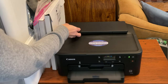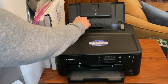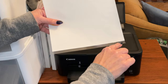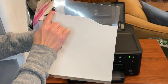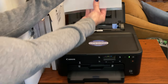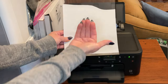In this particular model I find that it feeds through the back feeder, so I just open that up and then pull this piece forward. The paper comes with a little plastic strip sticking out at the bottom. This is going to be the top of the paper and it's going to feed through this way and print on the top. So whatever part that you want the printer to print on, you're going to want it to face towards you.